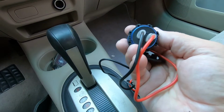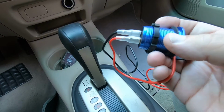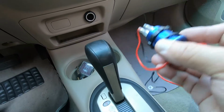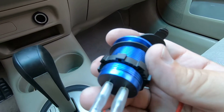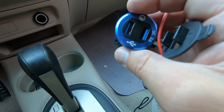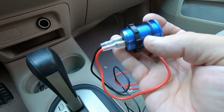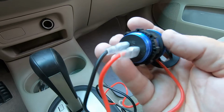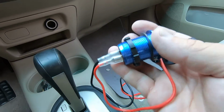It looks about maybe a little over 1 inch. You'd want to measure it, and get a hole saw or a grinder. You could use a little Dremel tool to just cut out a hole. You wouldn't have to be real accurate. You see how big of a flange is on this, so as long as you're not bigger than the outer diameter of the face here, you'd be all right. The closer to this, the better, obviously, but it's not that critical. They give you plenty of room here to where you could be a little bit off.